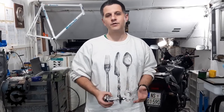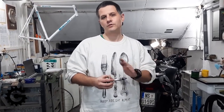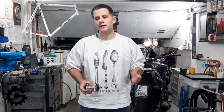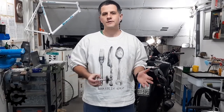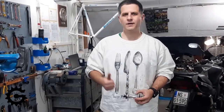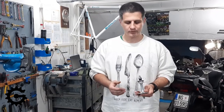With a wheel that has 36 or even 40 spokes — like tandem bicycle wheels — I've seen them break one spoke and almost stay true, because there is so little difference made by that one spoke going out of play. Such wheels don't necessarily even start scratching on the rim brakes. More conservative wheels with 32 or 36 spokes are in between, but for safety and durability it's better to have more spokes. Choose a hub with at least 32 or 36 spokes.